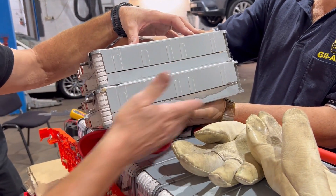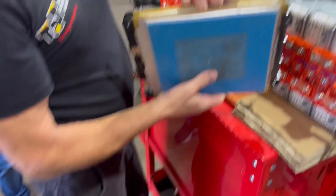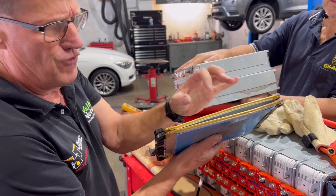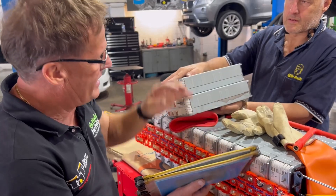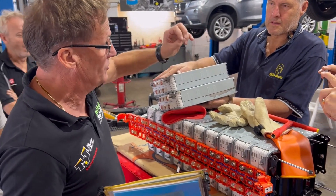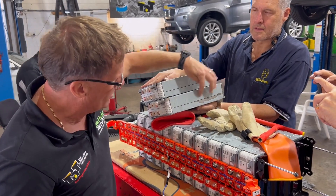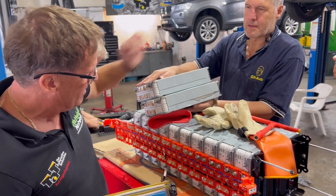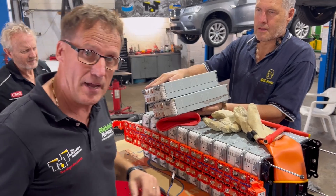We've stripped the battery pack down and removed the offending cell. Straight away we can see some serious leakage. Inside these battery packs, we've got pouch cells — these membranes are like little pouches, each a lithium-ion battery connected through the terminals. One of these has sprung a leak. There's no fluid as such — they're a gel-type battery — but when they get warm, the gel becomes more liquefied and leaks out of the cell. Interestingly, the car wasn't that concerned about the 0.03 volt difference, but it did flag the high voltage insulation leakage, which shut the vehicle down. We just need to find a replacement battery, balance it to 7.27 volts, install it, put it all back together, and get this car back up and running.